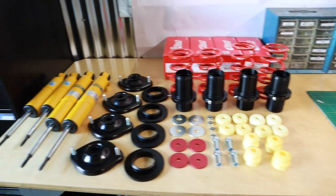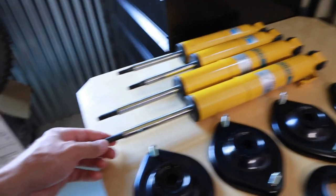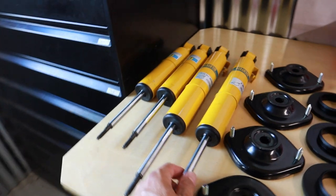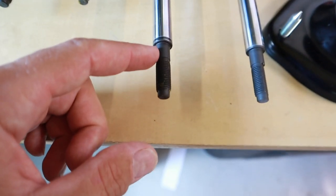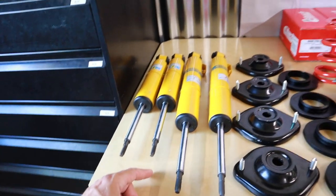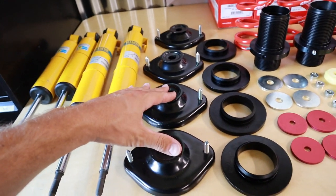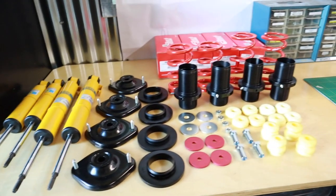We hope this helps you understand our coilover kits a little better and why we made them. Our coilover kits are based off of a Bilstein off-the-shelf shock absorber — an OEM replacement shock absorber for the Miata. These are Bilstein HD, the B6 variety. The B6 just means it's a heavier-duty shock based for street vehicles. We can tell the difference between the NA shocks and the NB shocks by the shank on the shock shaft — the NB has a much longer shank.